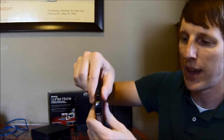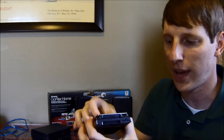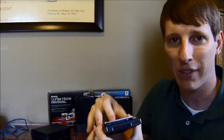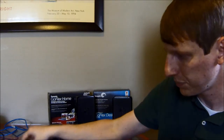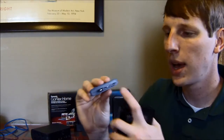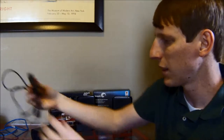This particular hard drive has an adapter that I can take off. If I remove the adapter, it has the same data and power connections that a regular laptop hard drive would have. Rather than connecting those two ports directly to our computer, we use an adapter that converts those two connections — the data and the power — into one USB connection. That's all this adapter does: converts data and power into one connection.